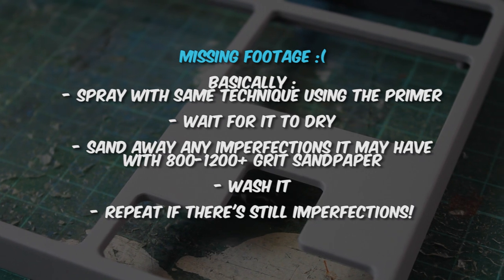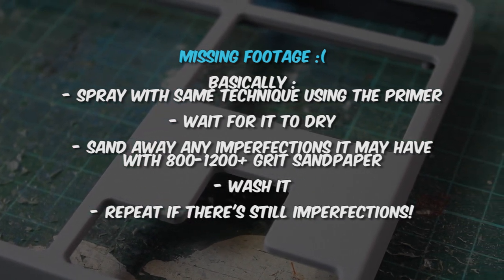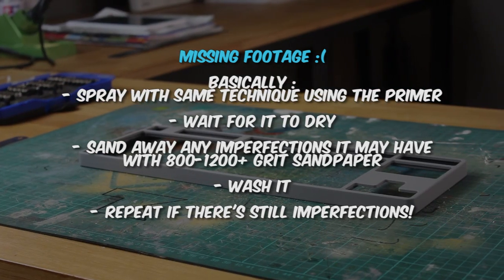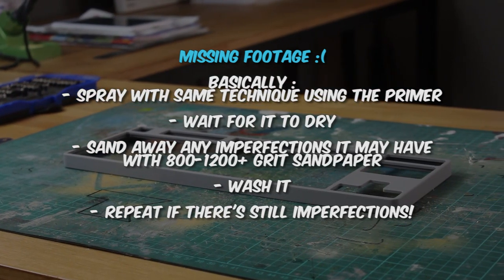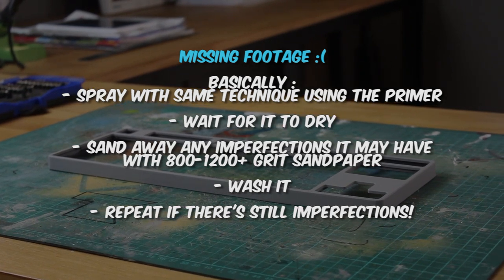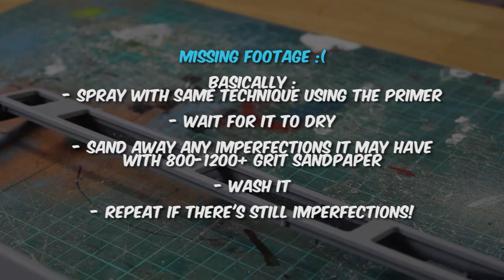Now just tape it off just like we did before, and have another round with a primer. This time I don't need to concentrate on the edges so much, so I can go straight to priming the main surface areas. If you still have scratches that were not leveled out during the sanding, you may have to lay on the primer a bit thicker, but since mine has a good surface, I'll only be applying some light coats.